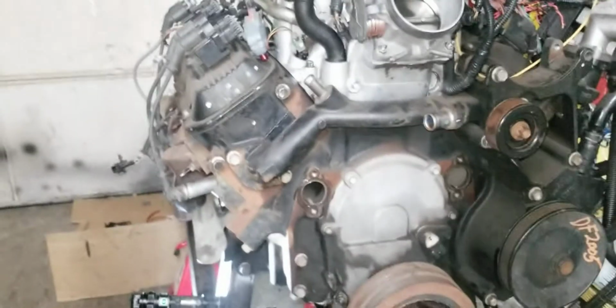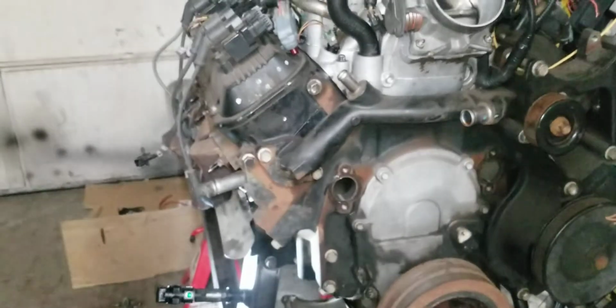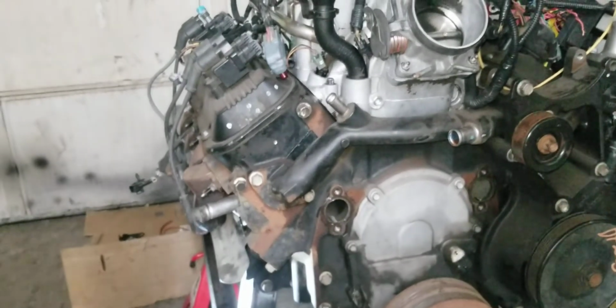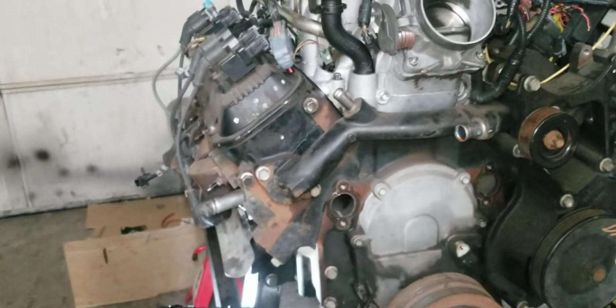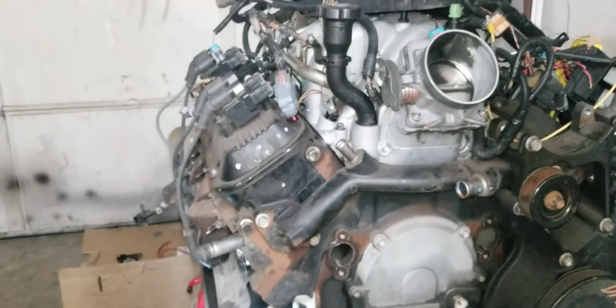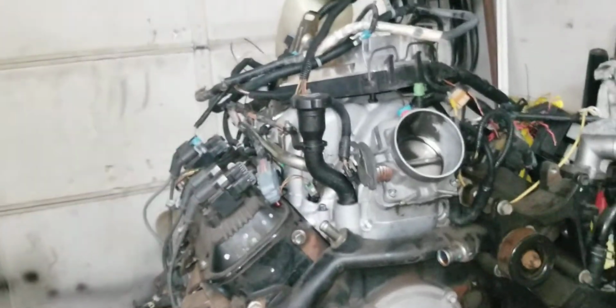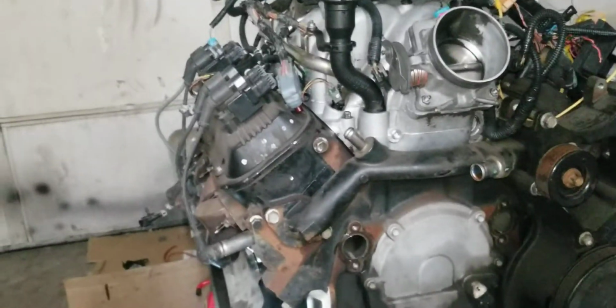I'm going to spin the oil filter off. Make sure I'm getting oil out of there with the canister pushing. Right? I'm going to spin the oil filter back on. I'm going to leave it on the whole time, just break the seal. Then I'm going to put 50 pounds on top of that. 50 pounds on there feeds the motor galley. 20 pounds. I'll crank it and start it.